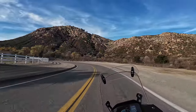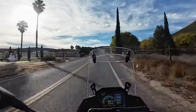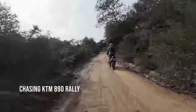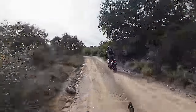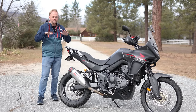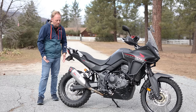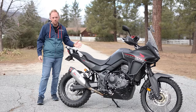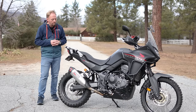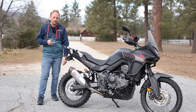I'm not saying I don't love the suspension — I do; it's amazing. If you like everything about the Transalp and you want the best performance you can get out of it, then this is the suspension to get. The adjustability, performance, tunability, and ride quality on and off road are phenomenal. It brings it up to be very competitive with those more expensive, premium adventure bikes. For most people, you could probably get away with just doing a spring change, although the suspension will be very springy and not have great control. The next step up from that would be valving and springs at your local suspension shop — maybe $1,000 to $1,500 — and you'd probably get a lot of performance for the buck. But if you want the ultimate, yes, this system is amazing. It's a super premium option and you have to be really committed to this bike to invest that level of money.